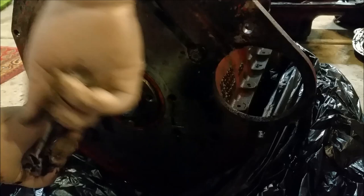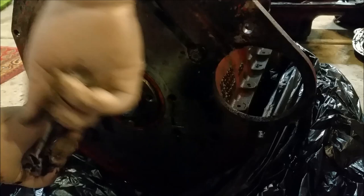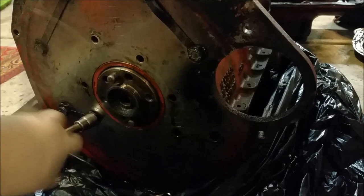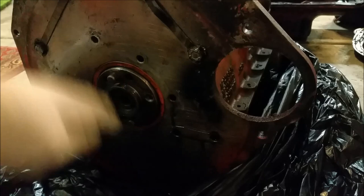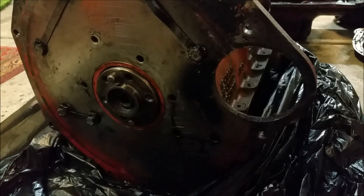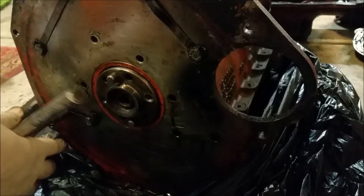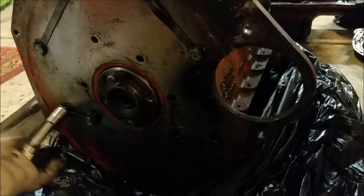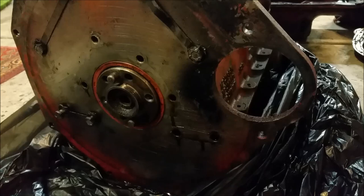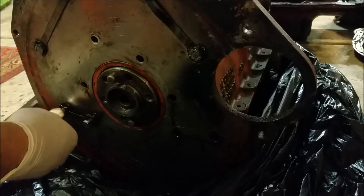You can see there's oil coming out of the thread holes — not a big deal. I'm going to put some thread sealer on those bolts when I stick them back in. Evidently this thing wasn't leaking from the rear main, which was my original diagnosis. The gearbox is leaking quite badly. It was mentioned that the breather box with the hose that goes up to the air filters can block, and the engine pressurises — oil pours out of every gasket and seal, which makes perfect sense. I thought it was engine oil though, so I'm probably wrong. But I'm glad we've taken this out — we're going to clean it up and put it back in.